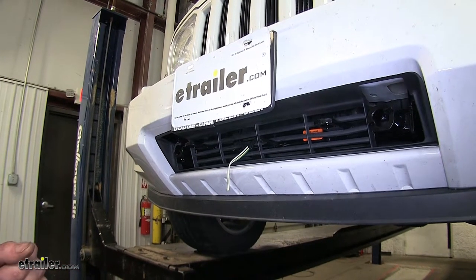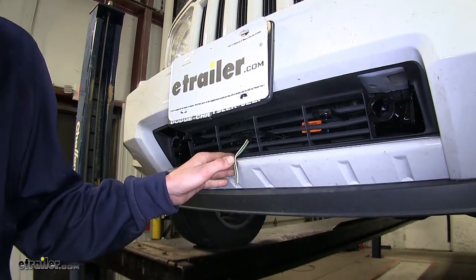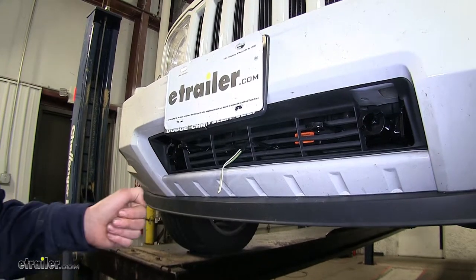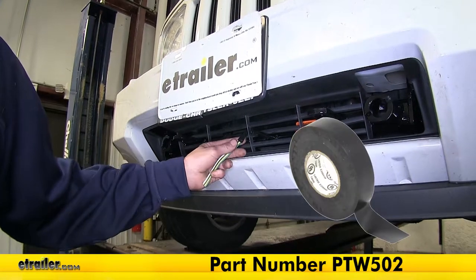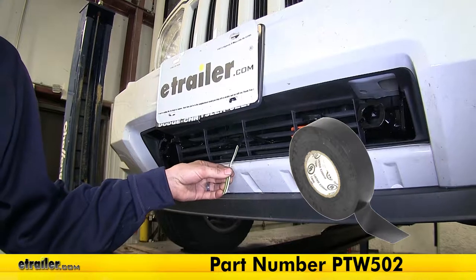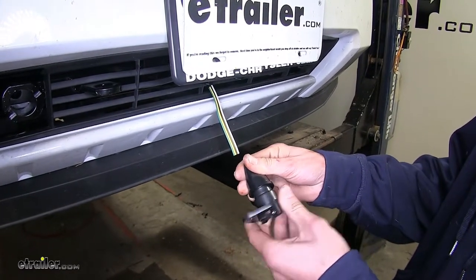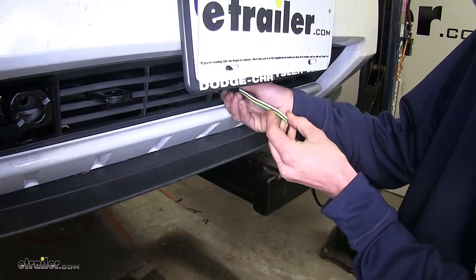To begin our install, we'll be at the front of our vehicle. We have our four pole flat wiring sticking out from our front fascia. We have this routed behind our base plate and zip tied up. We did this when we installed the base plate while the fascia was off to make it easier. We wrapped our wire in some black electrical tape so we don't see any colored wires hanging out behind our fascia. Now we'll take our six pole connector for the front of the vehicle, pull off the dust cover on the back of it, and slide that over our wire.